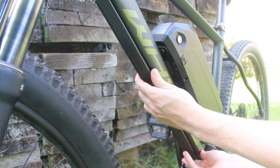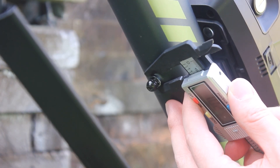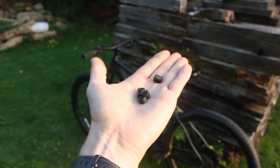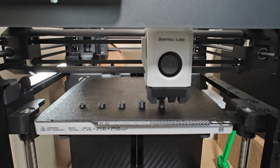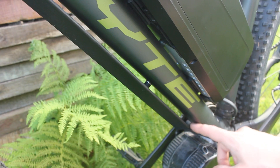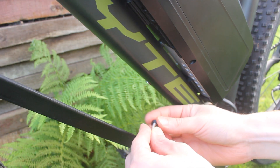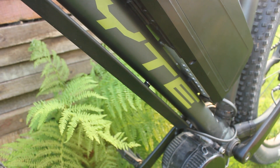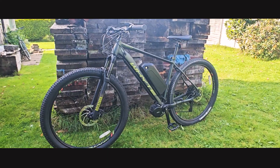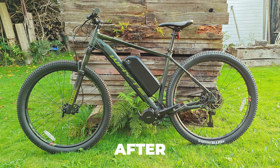The last little modification I want to make is to add a small spacer to the bottom rivnut, so I'm quickly measuring up to design a 3D print — just a small plastic spacer to put around this nut. These are the five spacers I've 3D printed, all different heights starting from 4mm going up to 10mm. The 6mm spacer has much too big a clearance gap, so I'm going to go for a smaller one — the 4mm spacer. There you have it: a finished, fully custom 3D printed cable management solution.